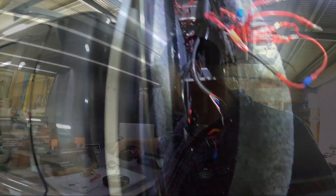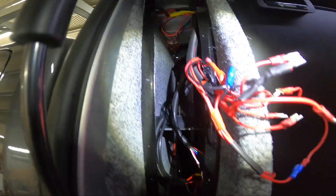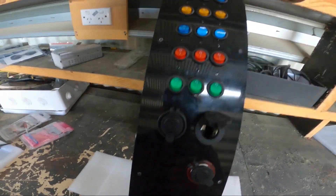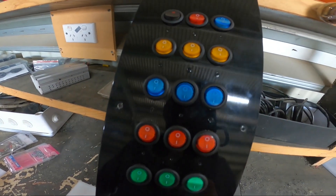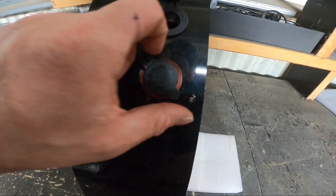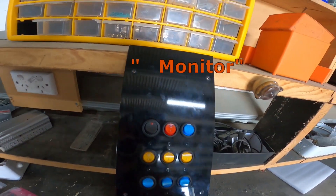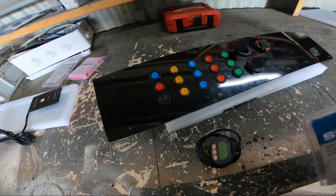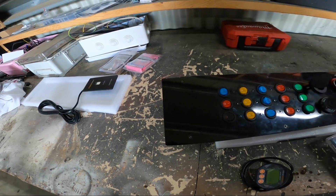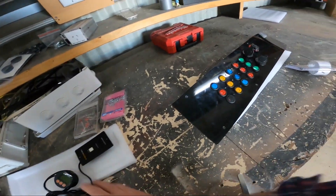There's the cavity for the batteries — it's only 130 mil across. Across the face here on these black bits of angle will sit the switchboard. Here's our switchboard — up the top you've got all your switches, some just wired to blanks at the moment; down here there's a USB charge point, a cigarette plug, and an actual cigarette lighter. We're going to put the monitor up here in the top section, out of the way. To install it you'll need a 54 mil hole saw — find your spot, do a pilot hole, then drill through with the hole saw and test fit it.